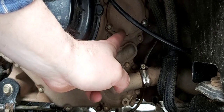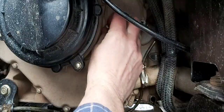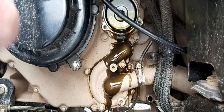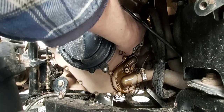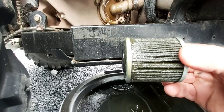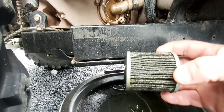Next, I'm going to take off the three bolts holding on the oil filter housing — again, it's an 8 millimeter socket. There's the oil filter we took out. The oil in it actually looks like it was fairly clean, not too dirty. But I'll probably be doing this a lot more frequently than the last owner.